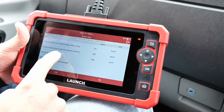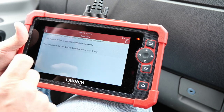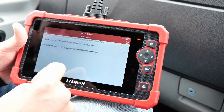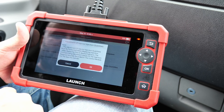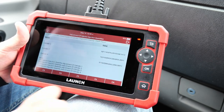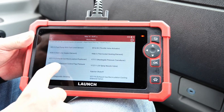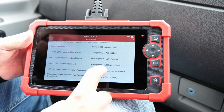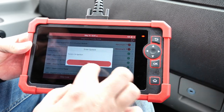Zero quantity calibration — after you change or clean the injectors you should do this operation: quick teaching of zero calibration values at idle or while driving, and adjustment of injector quantities. So when you swap injectors you can input the new values right here. These are all the engine components — a lot of them. I don't think I've seen a scan tool capable of doing so many things. Let's go to the SAM actuation module, which handles lights and so on.